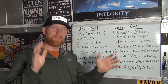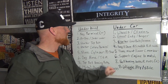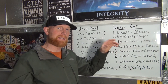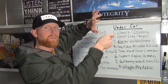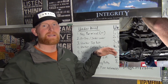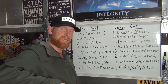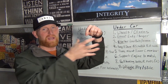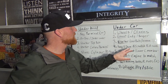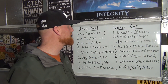Exhaust ends — I'm talking about where it mates into the back end, the little up-and-over pipe that goes over the rear axle. Next, pull the starter. I already did the top starter bolt and all the connections to it, so the only thing holding it in is the bottom bolt. Hold the weight of the starter up, pull that bottom bolt out, pull the starter out, and hang the harness down. There's a harness that has all the wiring for your backup light switch — when you put your gear shifter into reverse there's an electrical switch on the transmission. If you pull the transmission back with that still in there, you're going to bust your switch. Two switches you really have to look out for: the neutral safety switch and the backup switch. One makes your key not work if you're not in neutral or don't have the clutch down.